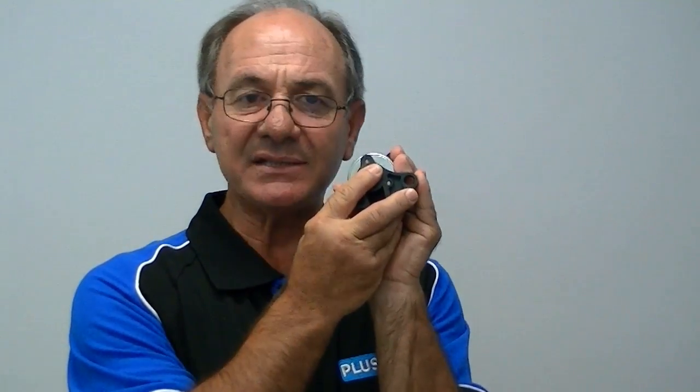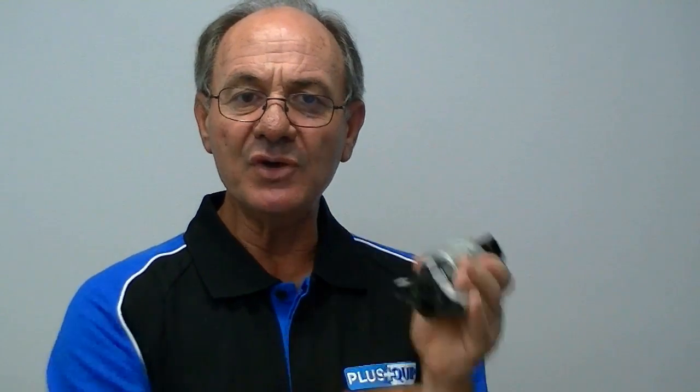This test procedure on a conventional EFI vehicle during engine running should cause an extremely rough idle and possible stalling condition as the dial percentage is increased. This verifies that the EGR valve pintle is moving. Moving the dial back to 0% should shut the EGR valve.